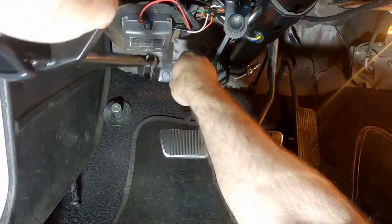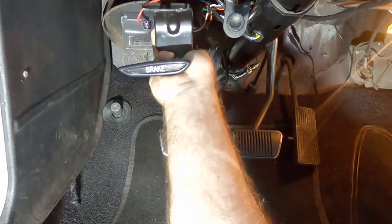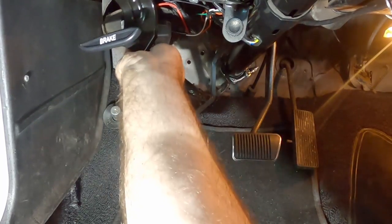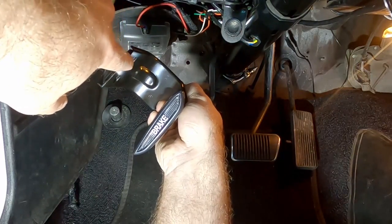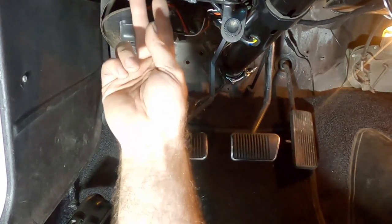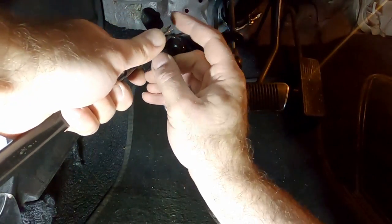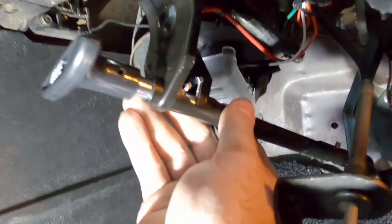Now we need to install it in the car. We need to make sure the holes in the firewall line up, and this piece goes on the dash — actually up on this edge. We need to finagle this around to get it up here. It didn't come with the fasteners — the two fasteners we need are 5/16-24 thread to make the nuts work inside this piece. Let's get those bolts so we can put this up here. Almost forgot — we have to put this pulley back in, pull back to normal position, put the pulley in, insert the pin, and the cotter pin.